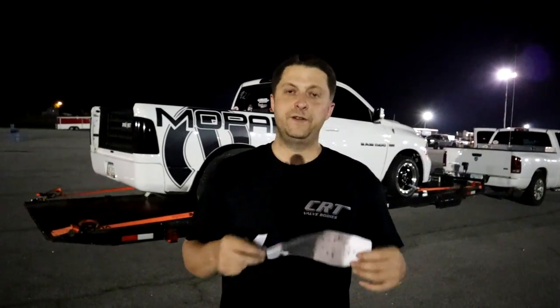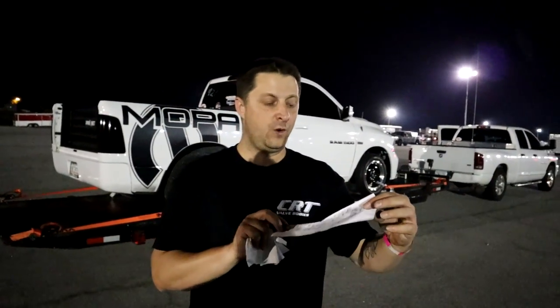So I don't know, I expected a lot better 60 foot, but I think that initial tire rotation of spinning before it bit cost a lot. That was a 1.714 60 foot, but we did run an 11.998 at 112.50, so it did make a little bit more power that pass and a little faster time, obviously, because the 60 foot time did drop. So here's that time slip for the 11.998, where I just hammered the gas pedal and dropped the transbrake right off the floor.